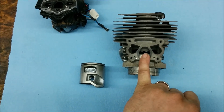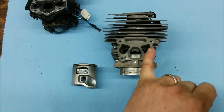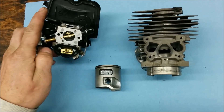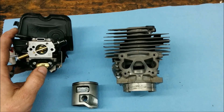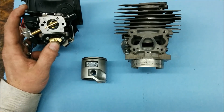This is your typical intake that fills the crankcase volume full of your fuel and air charge. These side ports are actually clean air in the intake manifold that fill the upper transfers simultaneously to the crankcase being filled with fuel and air.